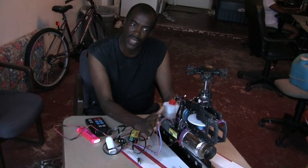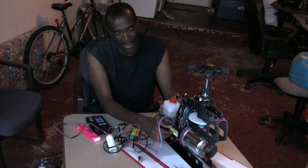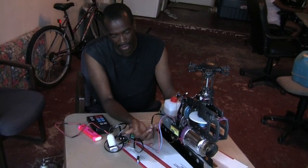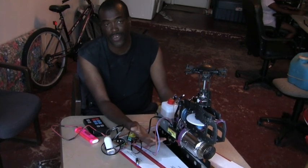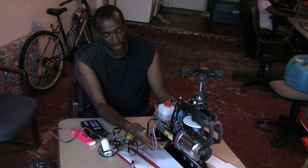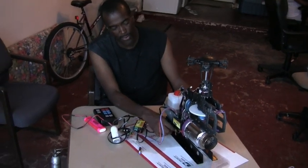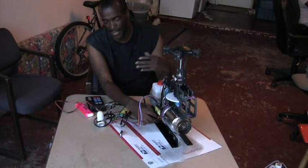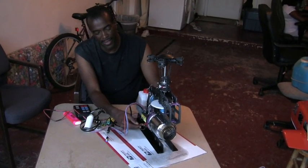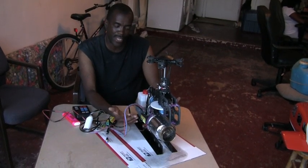To me, I like everything simple and easy to access — that's just the way I build. It's a preference. But I find that if it's very easy to access, it's easier to maintain and change stuff out. This is very mechanical. Stuff can go electronic. This does break, not very often. So by having everything attached to the frame itself, if you want to change the fuel valve or the fuel line, it's right here in front of you. You pop it off, put the fuel line on, and you're done — a couple of minutes.